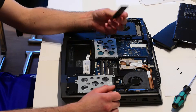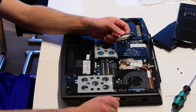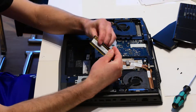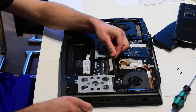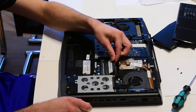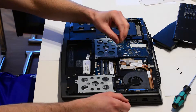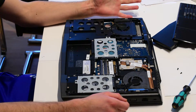I'm only having one card so I could actually do an upgrade, but I don't need it because I already have two 8GB RAM slots at the front of the laptop below the keyboard. So I'm just gonna put this back in. It can only fit one way because of the hole in the card. You put it vertical like this, and then push it in at an angle and push it down so it's clicking onto the metal pins again.